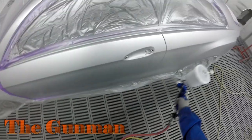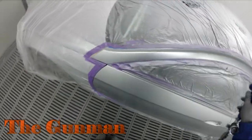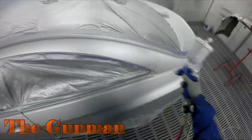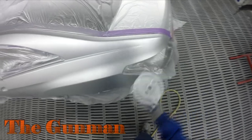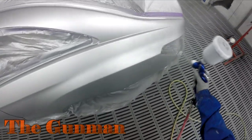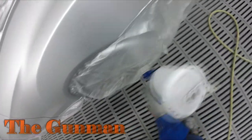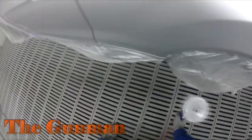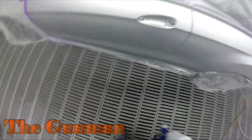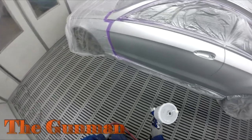This is me doing my blend. You may have noticed with that ANI F-150 gun I was putting a bit of blending aid down — that's literally just Standox 599, one of the tinters. When you're mixing up a three-layer pearl you put that in first, then a little bit of the pearl. It's basically just a clear base coat. I mix it up at a one-to-one ratio, keep it in the ANI F-150, give it a quick shake when I'm ready, and off you go.